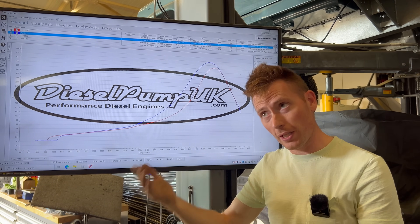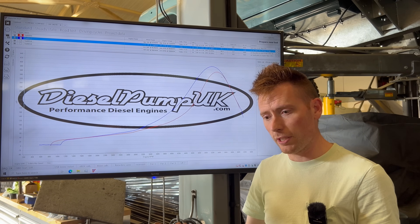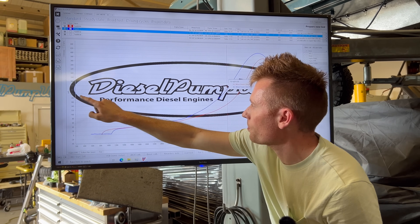Because the turbo was so laggy and so late, the pump was starting to pull the fuel back — it was getting to the end of its rev range, so it didn't get to make its full potential. Yes, under load on a retard it might be the same, because it is the same. Look at that — that is a big difference.